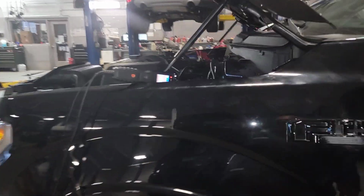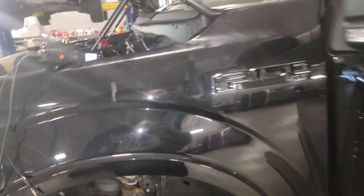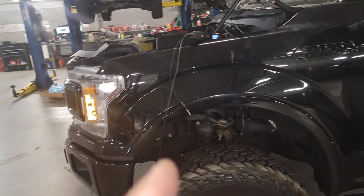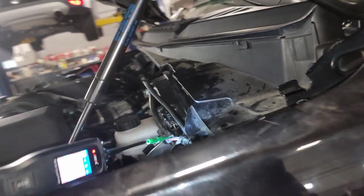It went away. Now it has voltage on that ground pin. You need to drive this vehicle a half mile before it will give you ground back on that circuit, because it wants to make sure there's sufficient vacuum to release the IWEs. So you will be in four-wheel drive.